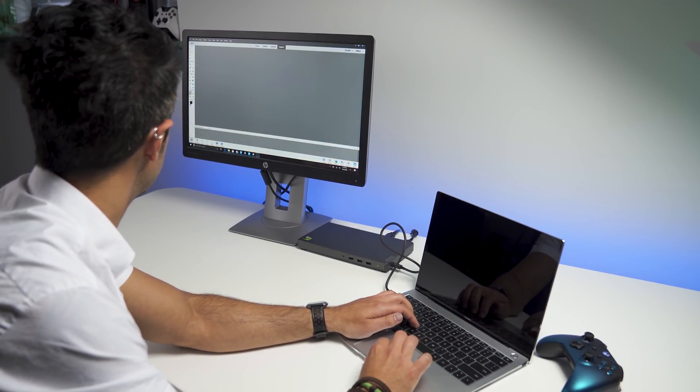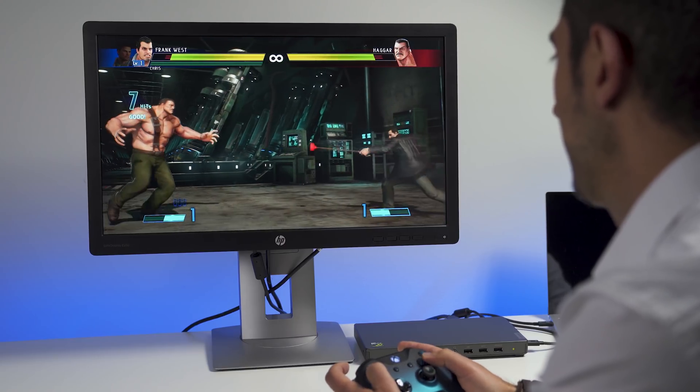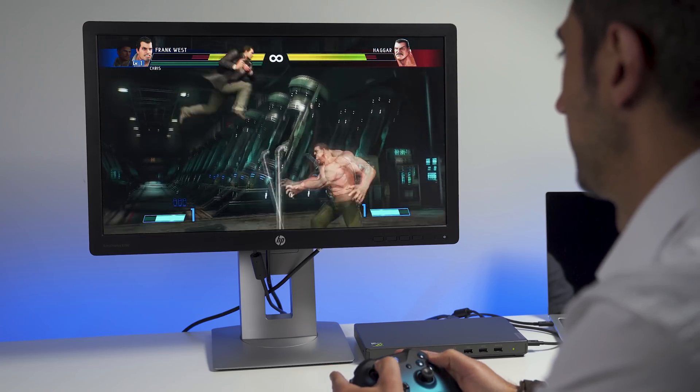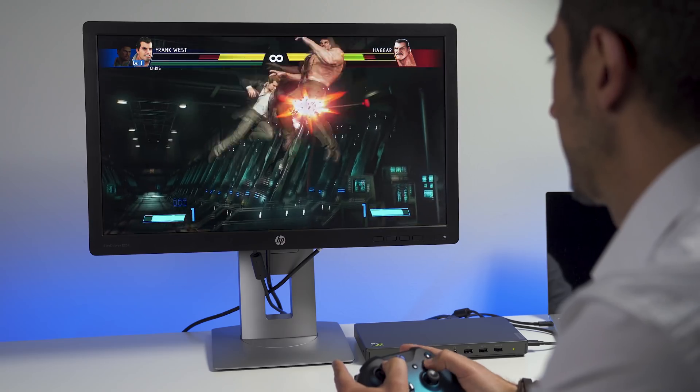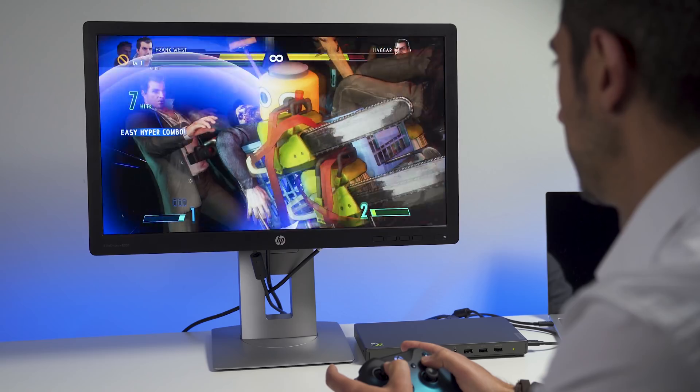There are still some quirks people need to realize. When you plug in an external graphics dock to your laptop without running an external display, you may run into bandwidth issues, as you're sending the signal back and forth through that single cable. That's why most people use this in a scenario where they connect an external display, so the signal uses the GTX 1050 directly. In terms of raw performance, it gets around 75,000 on Geekbench, which is exactly what we expect from a GTX 1050 — matching the Surface Book 2 13-inch, which also has a GTX 1050.